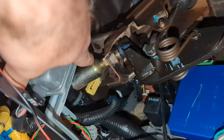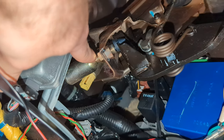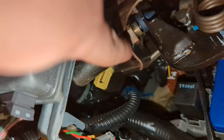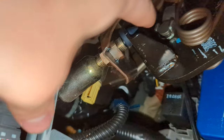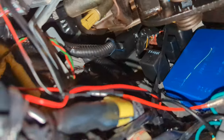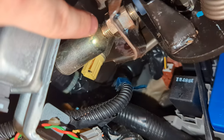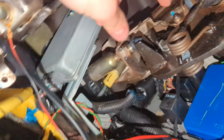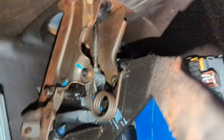There are two adjustment points here. First, this clutch switch — I think for cruise control — you just want to make sure the threads on the switch don't touch the grommet on the blue thing here. You can loosen this nut and adjust it to make sure there's just a little gap there. Then on the actual clutch pedal adjustment itself...